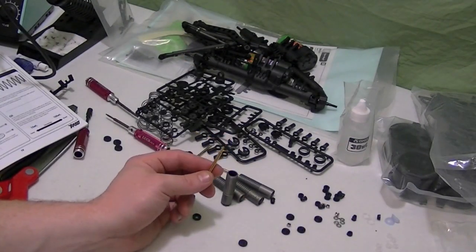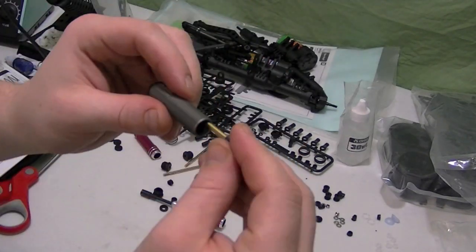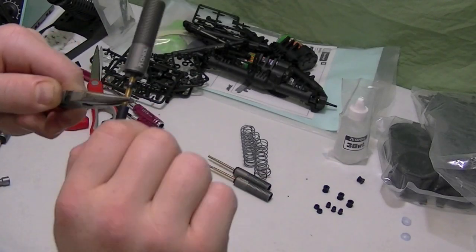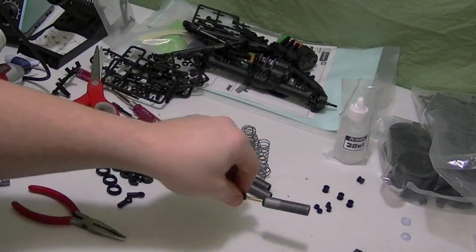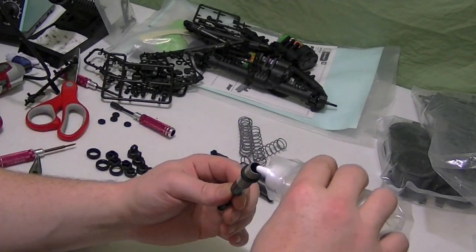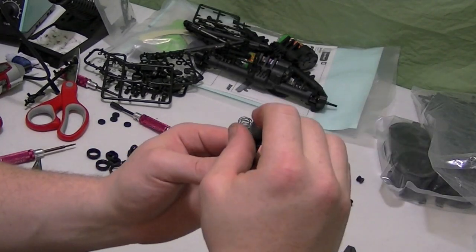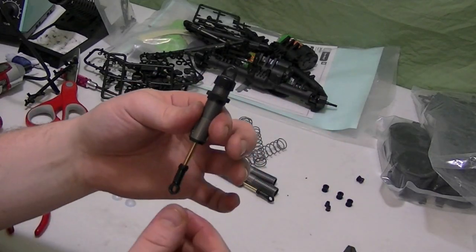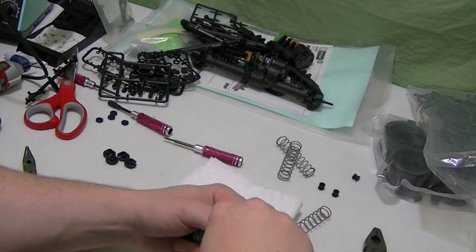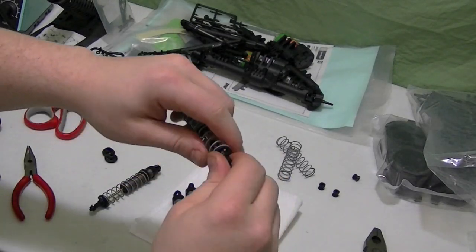Now for the piston, we're going to put in the rod, the washer, and the plastic diaphragm, and another bolt to hold the whole thing together. Push that through the shock. Put in the ball end — there's a flat spot on that bar to hold onto, so I'm not scratching up the shock shafts. Thread in the spring adjustment and we're going to fill up the shock, work it in, get our bubbles out. Put in the rubber diaphragm and then the shock cap. Now we're just going to push the shock through — there's a retainer to hold the shock at the bottom. Do the same to all four.